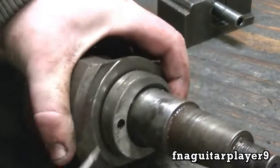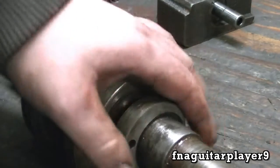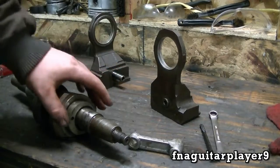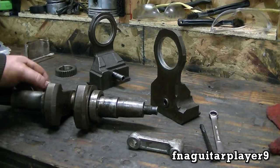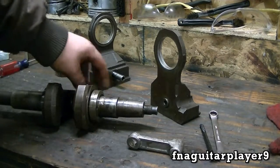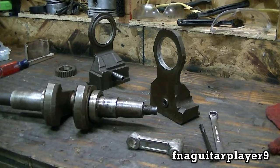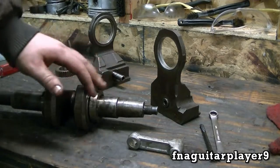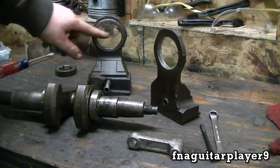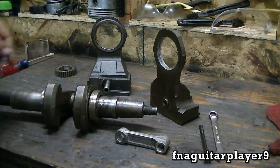You can see there's a pin right here that lines them up - they just pull right off. Sometimes you have to replace these if there's too much wear on them. Most people don't ever take these things apart. If you ever get an old engine that has a knock in it and you tear it down and measure the journal and the rod and everything is in spec, it could be a little bit of play in these eccentrics making the knocking sound. It won't really affect performance that much, but if they get too worn out they can seize up and break. I've seen videos on YouTube of these broke off. Now let's put this thing back together.